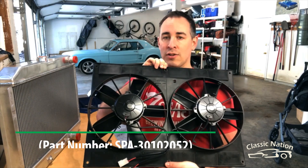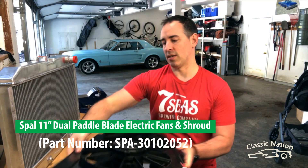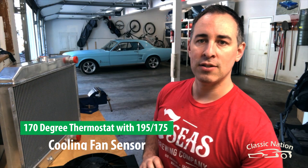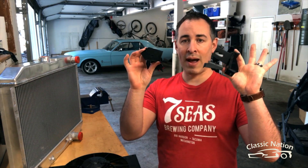Going on the back of the radiator is a dual electric 11-inch fan and shroud unit. I've got to fab this up because it doesn't bolt directly onto this radiator, but I've got a couple of tabs and brackets to make it work. I've got the relay harnesses for both fans — it should be pretty easy to wire into the existing unit. Going from a mechanical fan to electric, so there won't be any loss of horsepower. I've also got an aluminum bracket for the top and a couple of steel brackets for the lower radiator.